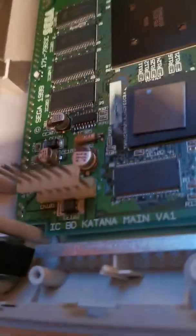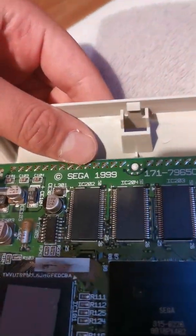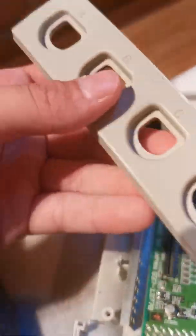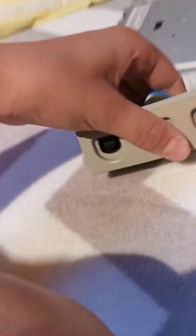Next up we got the motherboard. You may be wondering - come on, remove the motherboard - well, actually I can't, and the reason why is because of this expansion port. So let me just pop this out real quick. See, there's the expansion port, and if we go to the side of the console it says extension. Basically you just remove this and then you attach an extension. There's the little extension port, and that's actually what's holding the motherboard in place, which is a Sega from 1999. So it's really old. Let's go and remove these four controller ports like that, and actually I can show you how this works - the controller ports are here and then this attaches onto the controller ports just like so, and then the two screws go on top. So that's how the four controller ports work - that's very nice.